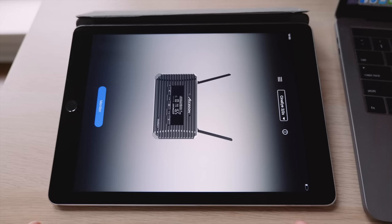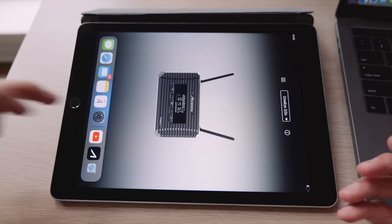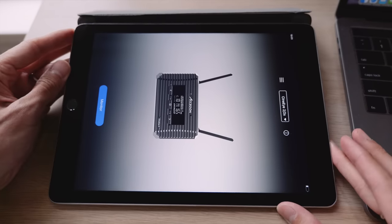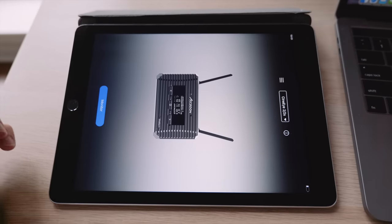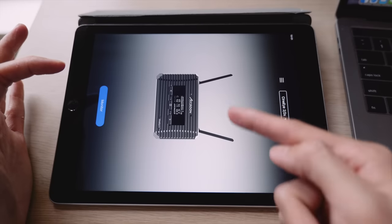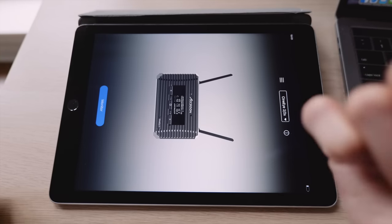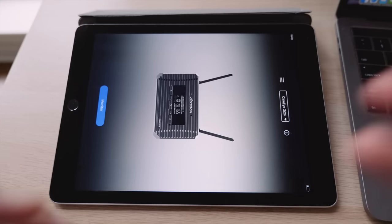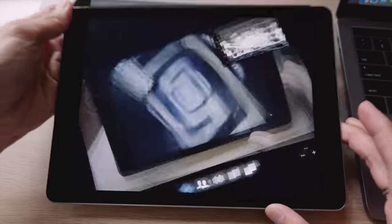The app has improved a lot but still has issues — it doesn't rotate to the correct orientation. It's also old-fashioned in that you have to manually go to system settings to join the Wi-Fi first before opening the app. Many modern accessories let you join the Wi-Fi within the app itself. Another issue: after joining the CineEye's Wi-Fi, the iPhone or iPad will still try to use that Wi-Fi to access the internet. If you want to live stream, you need 4G or 5G, but you have to wait for it to time out before it switches to mobile data.